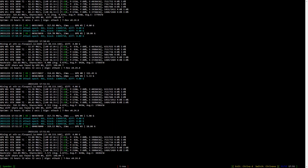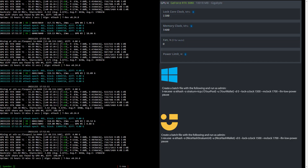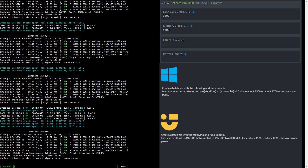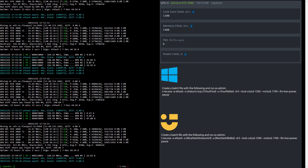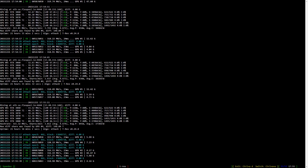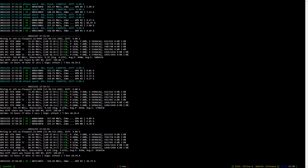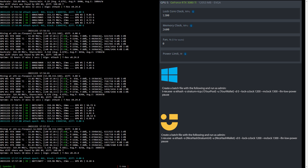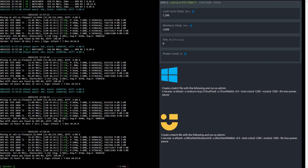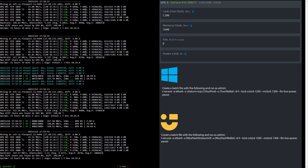Let's have a look at clock settings for the RTX 3080 LHR mining Ethereum. I lock the core clock to 1500 and set the memory clock to 3400 in Hive OS, which is 1700 in Windows. Windows and Hive OS users can create a batch file based upon what is displayed here. For the RTX 3080 Ti with the BIOS update mining Ethereum — if you don't know which BIOS update I'm talking about, check my channel for the video — I lock the core clock to 1200 and set the memory clock to 2600 in Hive OS, which is 1300 in Windows.